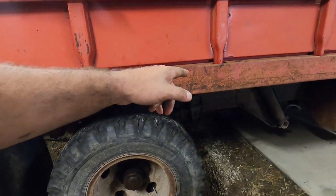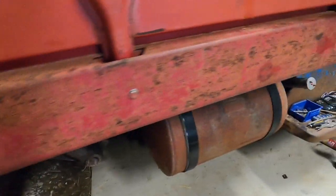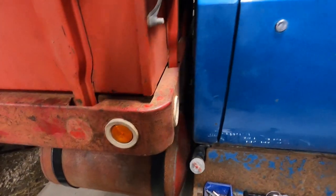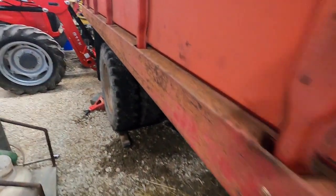It goes to a line on the frame, which goes up, and that's where we're going to connect somewhere around the cab, somewhere in there. On the driver's side, just inside the frame rail, that's where we're going to connect into the old system. So everything from there back is going to have new brake lines.